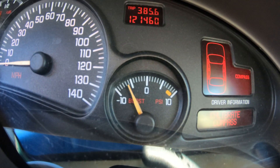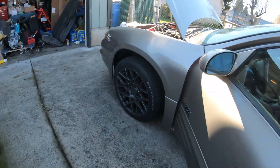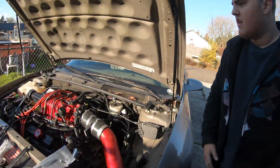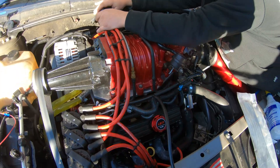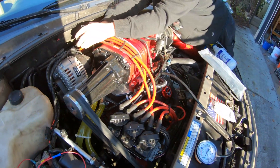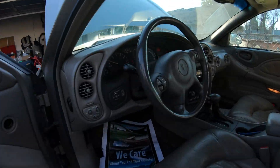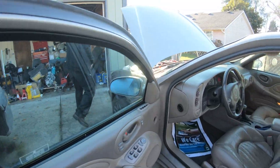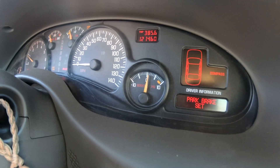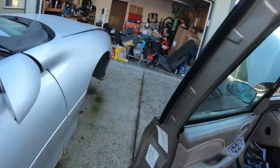Where does that lead to? Maybe that MAP sensor's bad. I'm going to test something — I'm curious what will happen if we unplug the MAP sensor. Should we unplug it or just unplug the boost line? Just unplug it electrically. Now it's reading zero, so I think that MAP sensor is just done. It must be. I'm going to plug it back in and see what it does — it's showing the same, like seven.